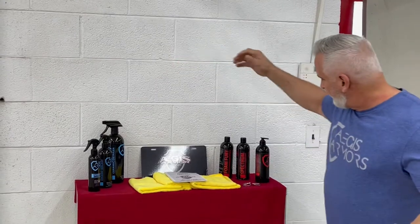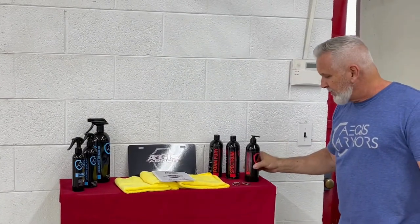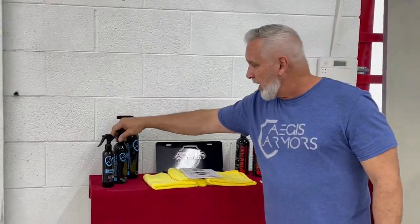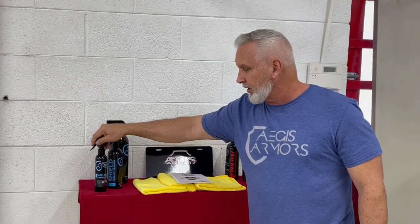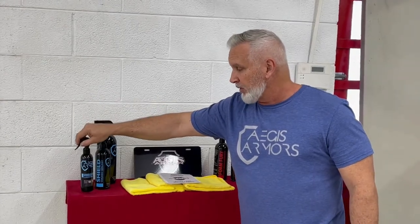On the vehicle that we just did in this video, we also used our Black Widow non-sling tire gel. This can be put on in a satin finish or a high gloss finish. For the do-it-yourself crowd, we've also got a couple products over here. We have Shield, which is a 6-month coating, and Shield Elite, which is a 1-year coating. This one is applied actually like you would apply real ceramic, doing a 2-foot by 2-foot area. Let it sit for about 15 seconds, buff it right off, lasts up to a year.